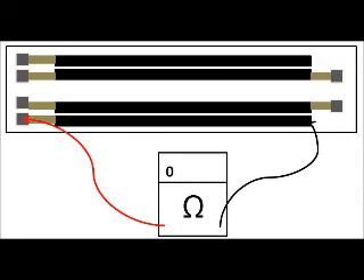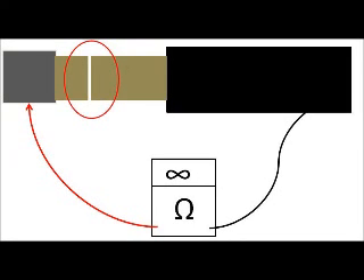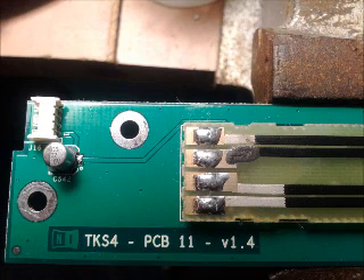On my S4 I had an open circuit, which was an infinite ohm reading. When I was looking at it I couldn't actually see the open circuit — it was probably just a hairline fracture. So what I ended up using to bridge that small gap was just a bit of wire glue, which is a carbon-based glue. Basically you just dab it on using something really fine like the end of a small jeweller's screwdriver or a matchstick. Just put a tiny little dab and that's all it needed. Allow that to dry for a few hours, then measure your resistance again to confirm the values I showed you before.